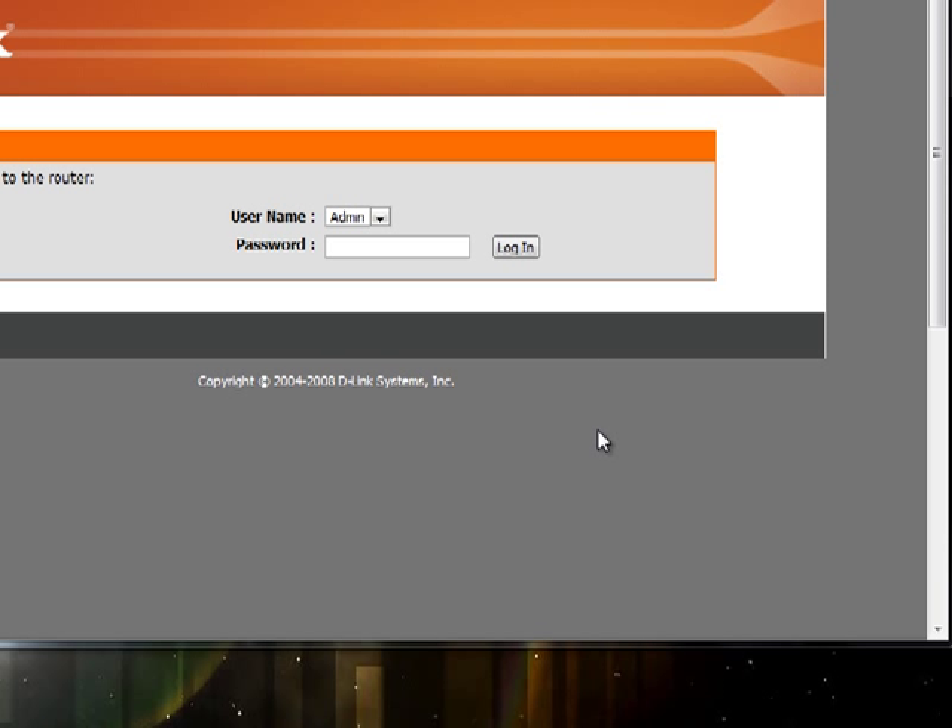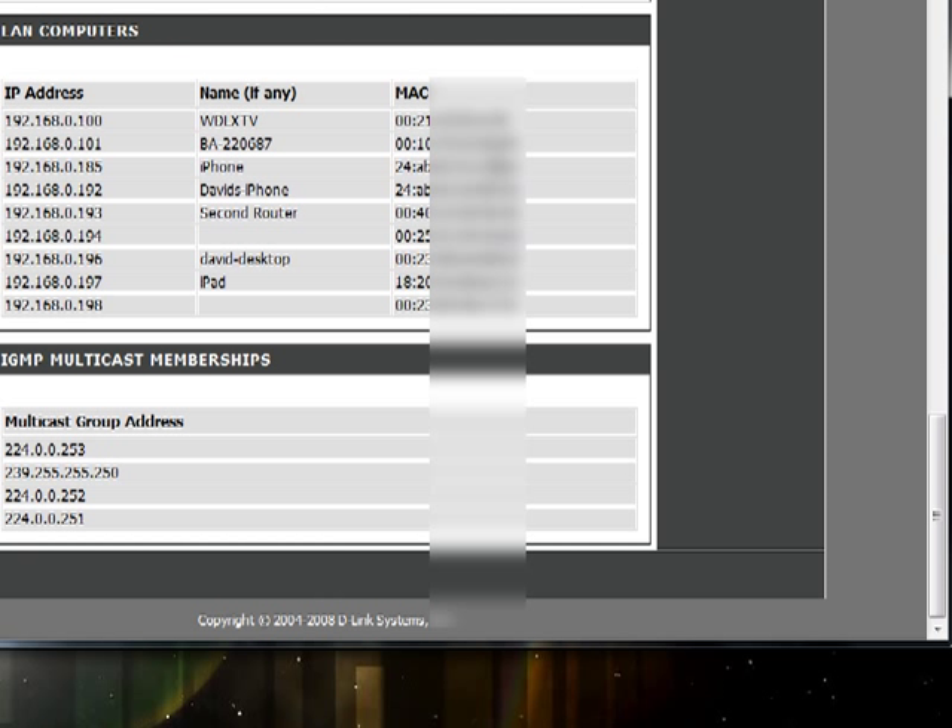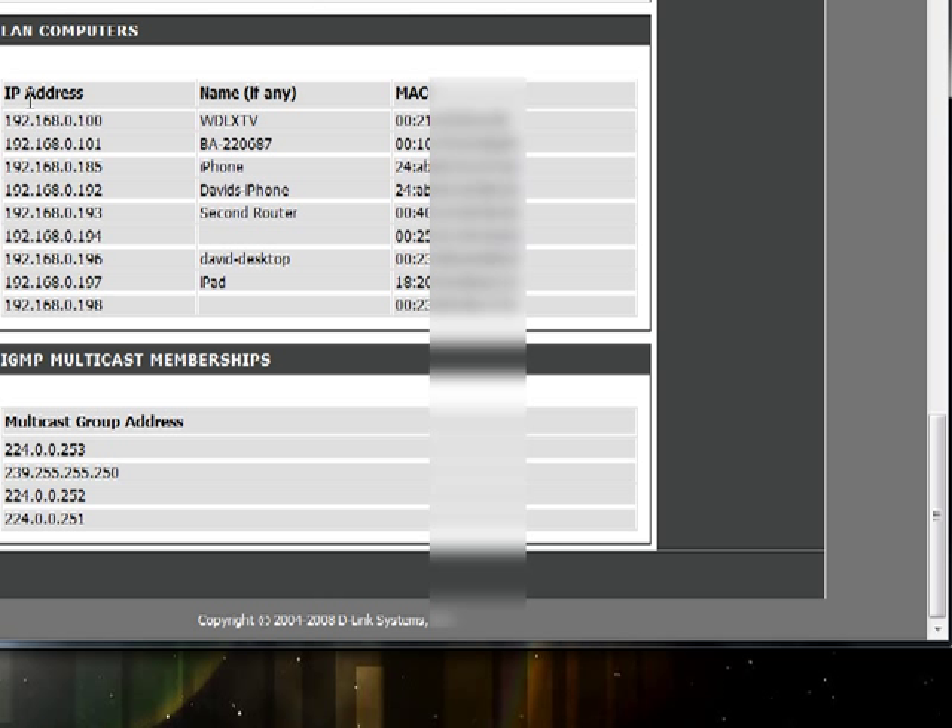With this here, it's really simple. The first thing we need to do is make sure you have enabled SSH through MyPogoPlug.com so we can SSH into your Pogoplug device. You'll need to go into your router and find the IP address for your Pogoplug. You should be able to find a list of IP addresses, the names of the computers, and the MAC address beside each one. Find the one that's yours.